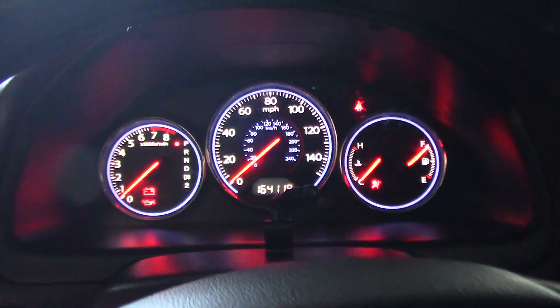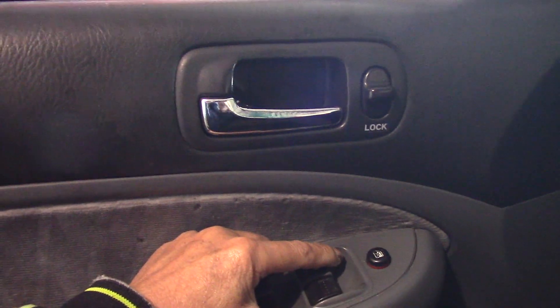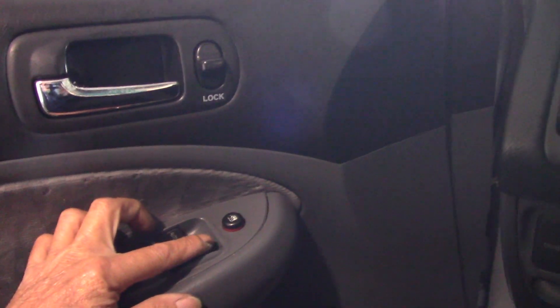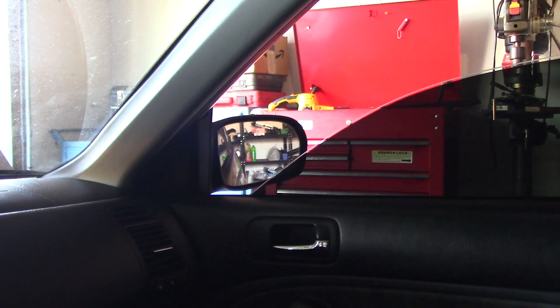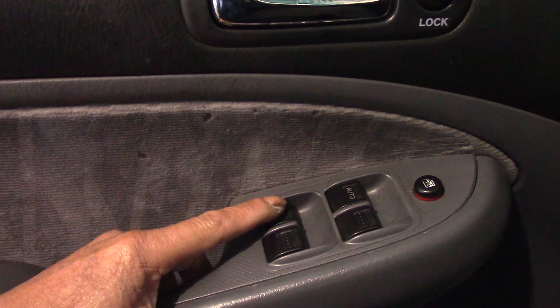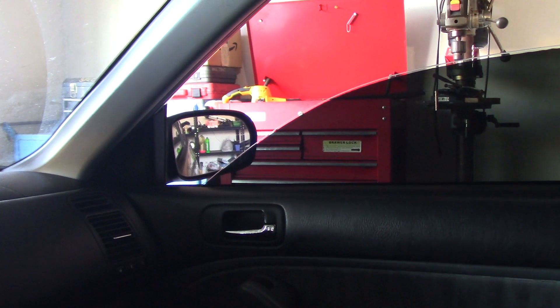Right now the key is on, guys. I'm on the driver's side now. I try to go up and down the driver's side window - that works. And then the passenger side front window, as you can see, nothing. The left rear window, as you can see, working fine. The passenger rear window? Yep, working fine. So the front passenger side window doesn't work.